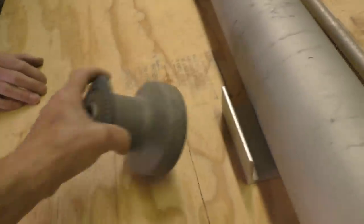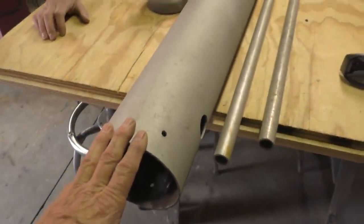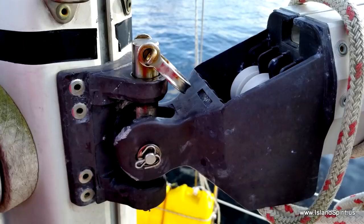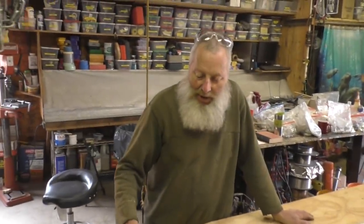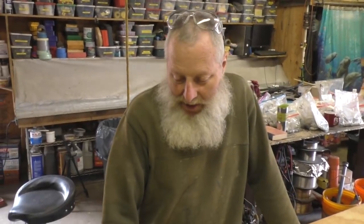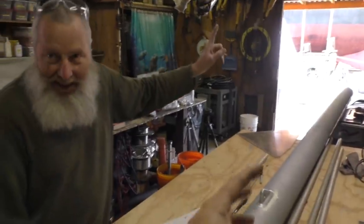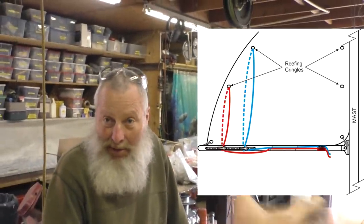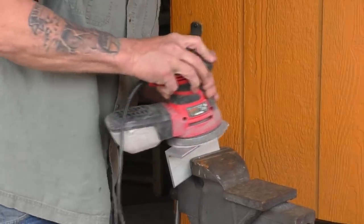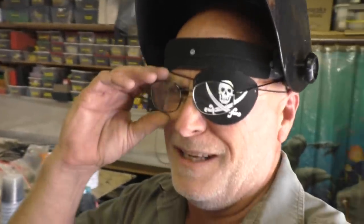The other thing we're going to do is add brackets to bolt those winches onto the boom. Down here is the gooseneck - that's the part that attaches to the mast. Why do you need winches down here? Well, these winches are going to be our reefing winches. We use them to pull down on our reefing lines and haul the sail down. The lines go through this and back all the way to the cars, and they pull the sail down at that end. It's called slab reefing.